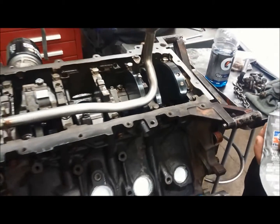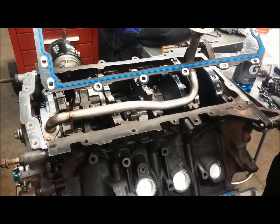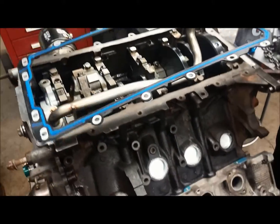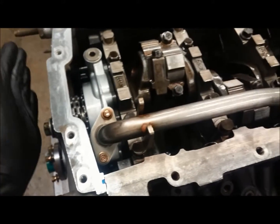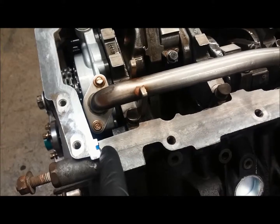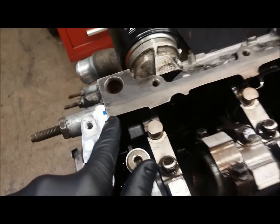In this video we wanted to demonstrate quickly a tip for when you install an oil pan gasket or a valve cover gasket. You see this gasket here — we're ready to install it. As we set it on this rail, you notice on either end there's a separating line where the rear cover or the front cover bolts onto the block. In those separating lines we need to apply some RTV silicone.